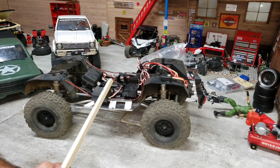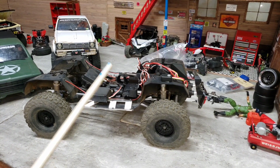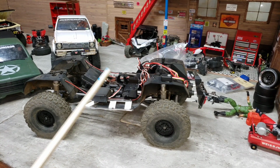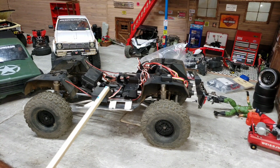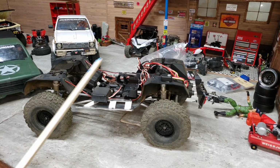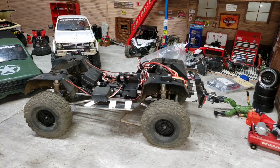I told you we'd go over some of the cons. The 2-speed is a nightmare shift-wise on these. You have to keep shifting them in and out, forward, backward, forward, backward. Brand new they don't do it, but once you start getting a lot of runtime, they start wearing. I got it working pretty good after tearing it apart, lubing the transmission up, going through it again, and putting in a higher torque shift servo. I do have it shifting in and out of first and second gear now.